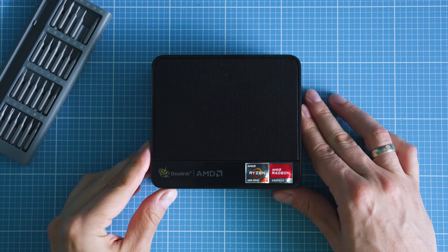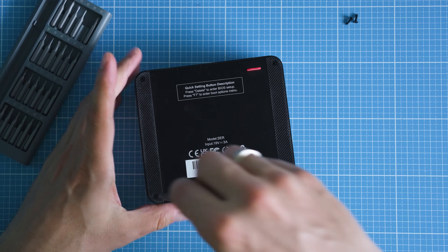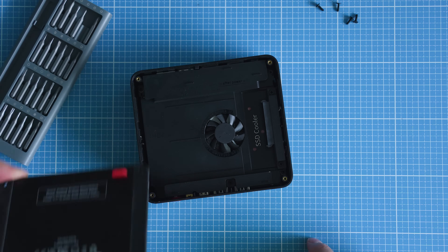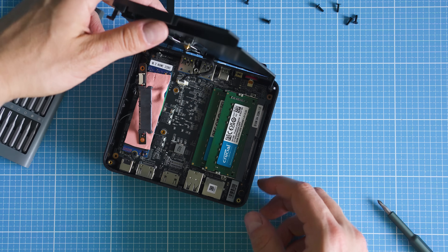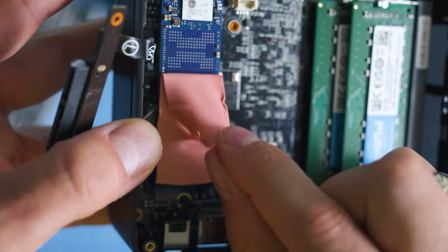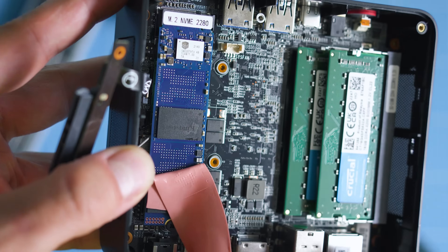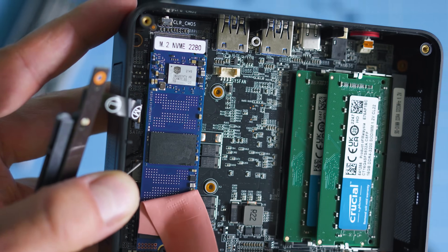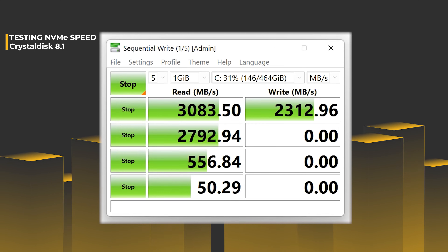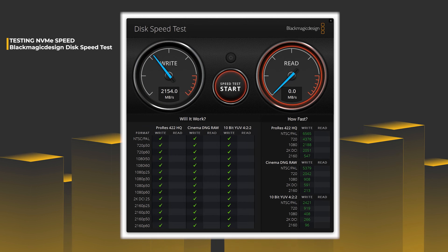We want to check the repairability and upgradability: four Phillips screws at the bottom which you need to remove prior to opening it. Excellent work on the internal layout — even at this small scale, there's enough room for everything. You can upgrade the memory up to 64 Gigabytes in total, and you can also upgrade the M.2 drive. Unlike some other reviews I've seen, this unit has a Kingston NV2 model running TLC flash, which won't suffer from performance degradation under sustained write stress. Read and write speeds are excellent, guaranteeing solid performance even for intensive tasks like video editing.